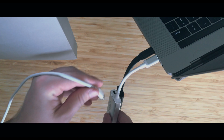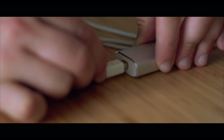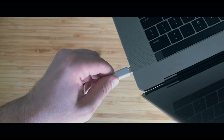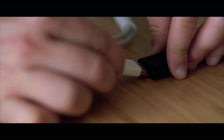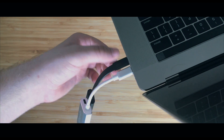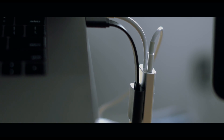This also has a convenient power pass-through for your power cable. Step one is to plug in the mini DisplayPort to the adapter, then plug that into your MacBook — you should see the display turn on. Step two is to plug the USB adapter into the USB cable on the monitor, plug that into your MacBook, and in your audio settings you should see the 24-inch Cinema Display as an audio device. That's all you need — just two simple adapters and you're up and running. It's not the most elegant solution, but it works and it's cost effective.